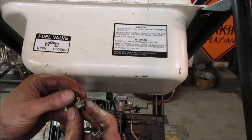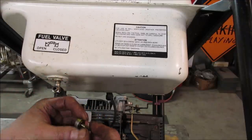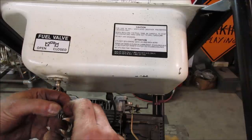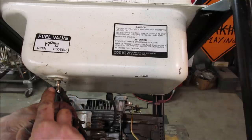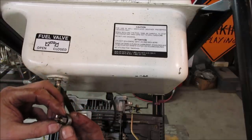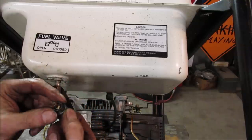What's left of it is gone. So there'd be a seal right in here, that this part of it, so you get to come down. That part right there has a seal on it. So as you crush this into there, there's that taper on it. It closes in around the hole and stops it from leaking up this end of it. It's kind of like a rivet on the end. You grind the rivet off, take the end off, take the seal off, and we change it.